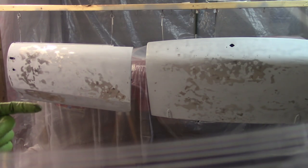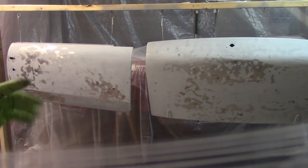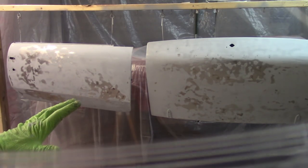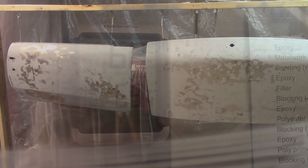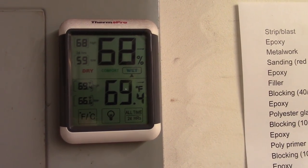I'm going to start with a relatively light first coat to try to correct the fish-eyeing or cratering I had in my panels the first time. Probably not as critical on the panels I've already painted, but the front valance here is going to be painted for the first time. The conditions in the garage are about 69.5 degrees.